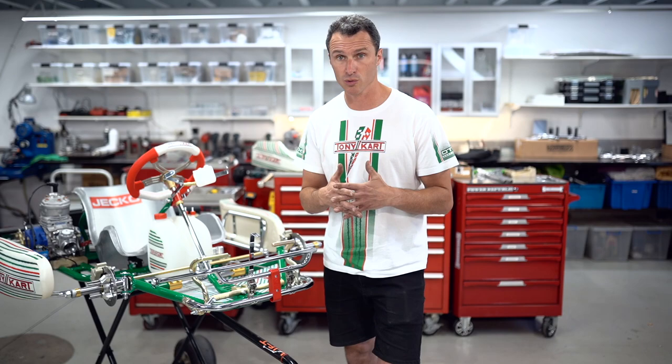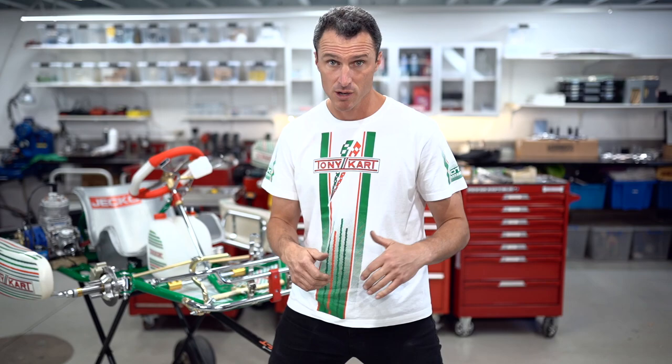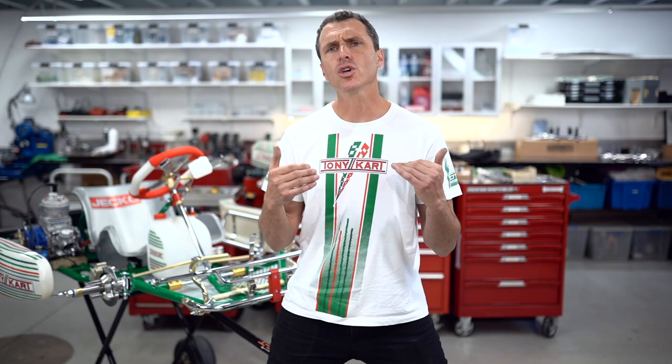With the smaller drivers, generally we can run in the top position. The bigger drivers, they're going to go down on the belt to get a little bit more leverage or a little bit more mechanical jacking. Also too, in the wet weather conditions, we can use that bottom position. You can also use the slotted steering column for some extreme grippy conditions, or if the cart's sitting crazy flat and you want to try to get that wheel up off the ground.